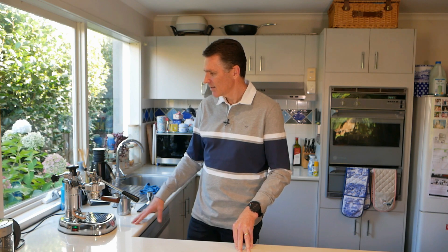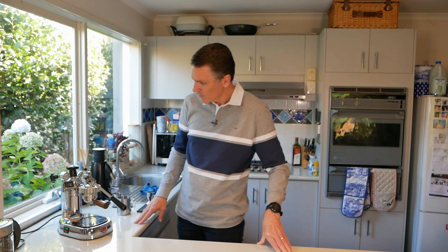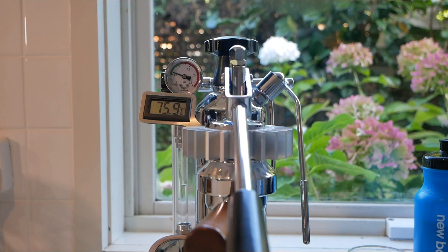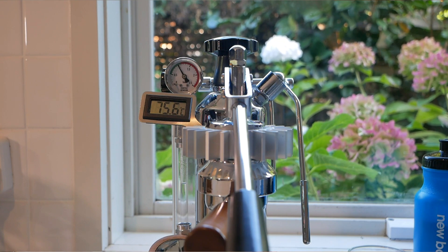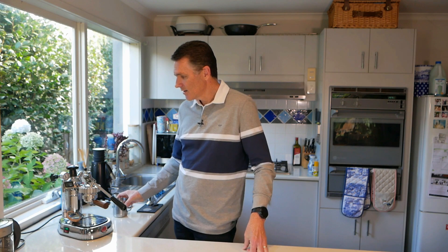And really, you're not waiting that long. With a lot of La Pavonis, you have to wait for the group head to cool down anyway, so it's probably time you've spent regardless. You can see on the pressure gauge I'm already up to 0.4 bar, 0.5 bar. We will have some false pressure in there which I'll bleed off, but still it's very quick to get ready. The capacity is the one advantage of the Professional and that advantage is negated just by having this simple technique to reheat the water ready for restarting.